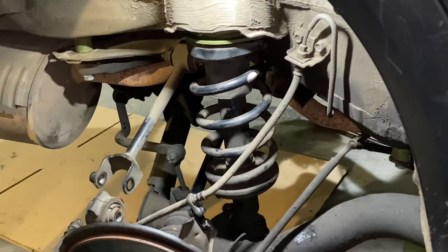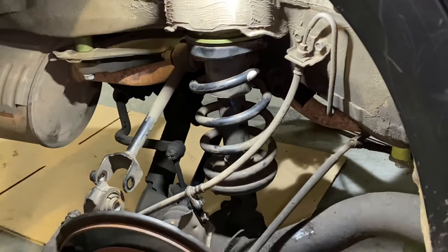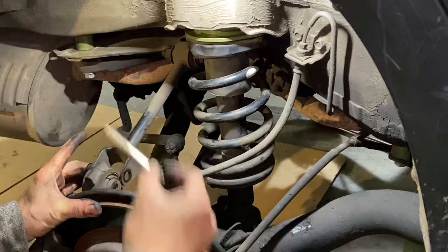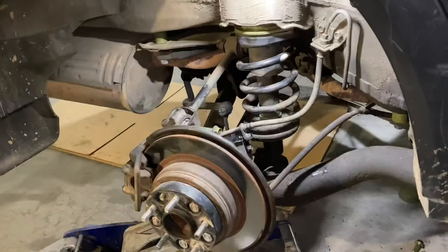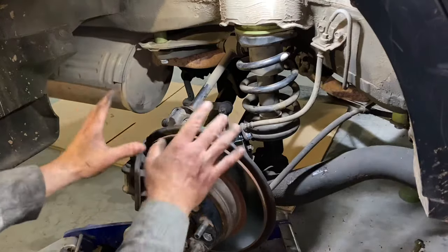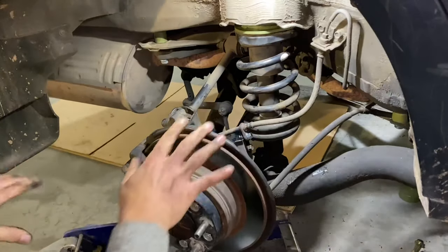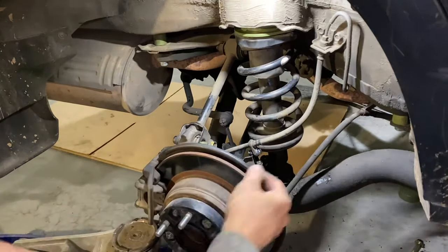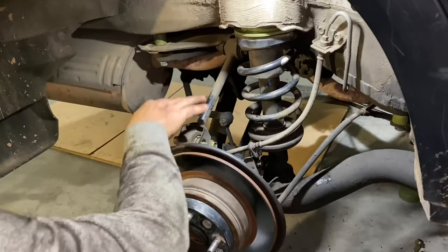What you want to do here is basically jack up the back to align that piece — very easily just get the jack underneath and lift it up. Then you can easily put that bolt back into place. Once it's all together, we've got plenty of slack on this brake line. It's important to notice that. You want to put your adjustable upper control arm in at this step.